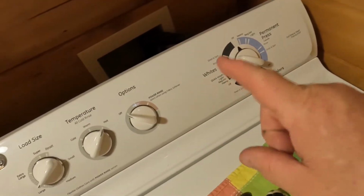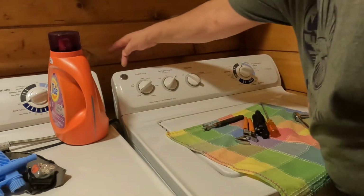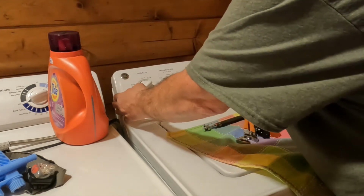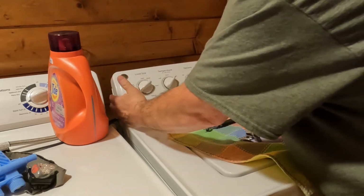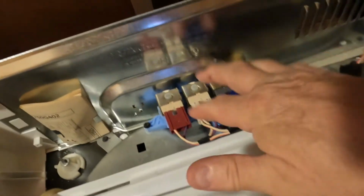But I want to show you how this front fascia comes right off. Okay, when you pull the 3 screws out, which are 1, 2, and 3, this makes it loose. And what happens is you have to grab this, and you're going to shift it this way just a little bit. It's very easy, and pick it up. Watch. Move it forward, move to the right, and pick it up, and it's off. You're done.